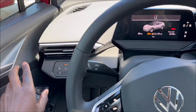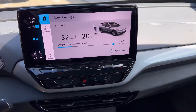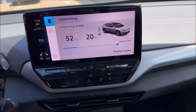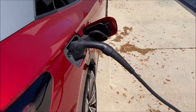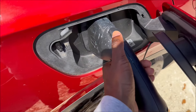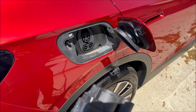That dashboard status bar is a cool Easter egg. Now we're going to stop the charge — press the button, stop charge. Please wait — it's going to unlock the charge port for us and the status light is going to change. Charging canceled. Now we'll get out and we should be able to just unplug it. You guys already saw that we couldn't unplug it while charging. Our status light has gone from green to white, and we can just pull it out just like that. It just gives you a sense of security knowing there are only a couple of ways you can pull this thing out.